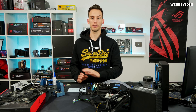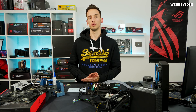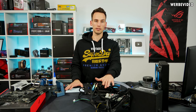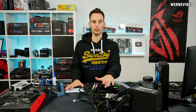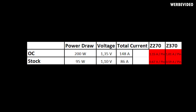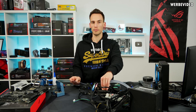In today's video we will analyze the socket and some single pins to see if we can overload them. I'm not sure if changing 14 or 18 pins will really matter. Looking at this setup — a Z390 board with a 9900K running Prime95 at 5 GHz, 1.35V, pulling about 200W from the CPU — we calculate 200W ÷ 1.35V = 148A total. On Z390 that's 1.01A per pin and on Z270 it would be 1.15A per pin, roughly 15% more load per pin.